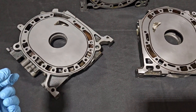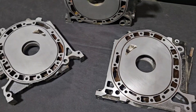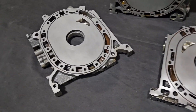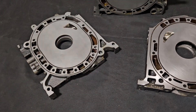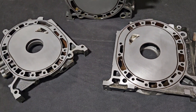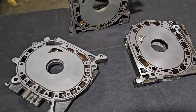Obviously they're not new after resurfacing — we cut some material off, but that's the whole point: a second life for this set of housings. If anybody has questions, definitely drop them in the comments below. Lapping is a popular topic. I think we should cover proper cleaning — it's really important to clean all your oil passages and the running surface itself. You basically want a sterile clean: wipe it down with a glove and nothing comes off. Maybe we'll do a video specifically dedicated to cleaning and preparation of used and lapped components.